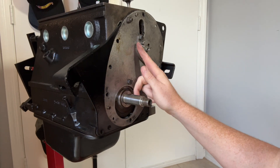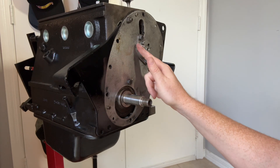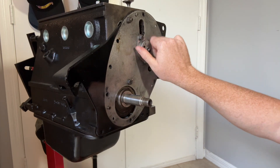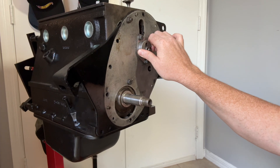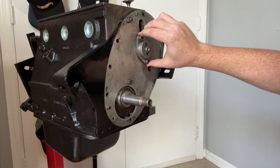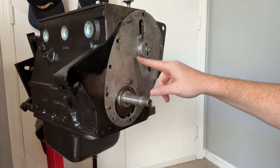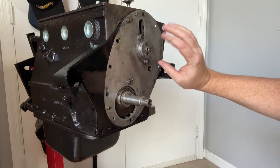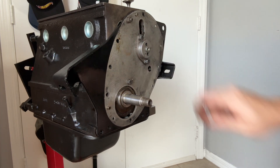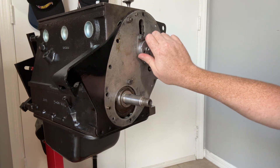I don't know why I didn't think about this before, but I used a little bit of sanding right where it was binding on the cam retainer. That removed just enough material, so now at 18 foot-pounds we've got nice free movement and the end play is exactly where I want it. The reality is that when you torque down on either end of the plate, the center section — which isn't retained — stays put while the ends pull in, causing a slight warp. I think we're actually better than factory on the end float now.